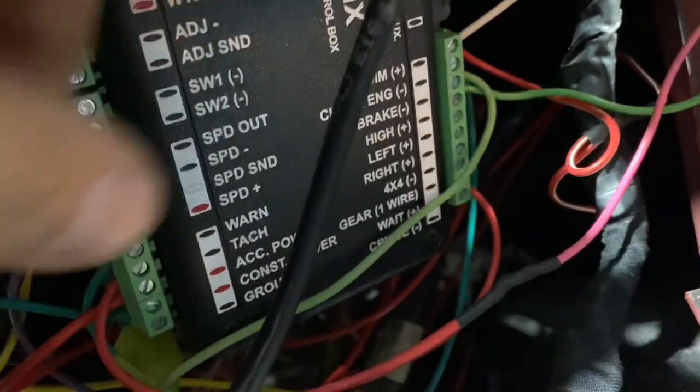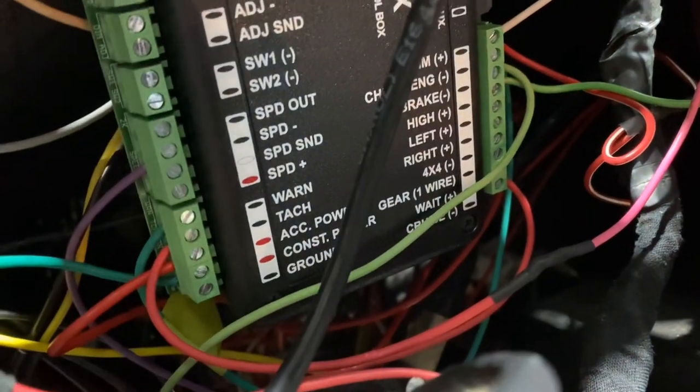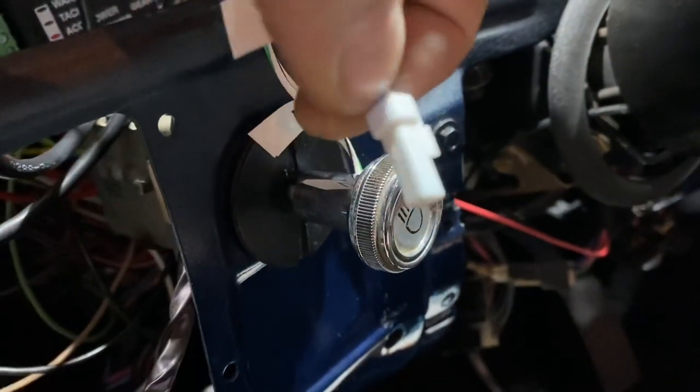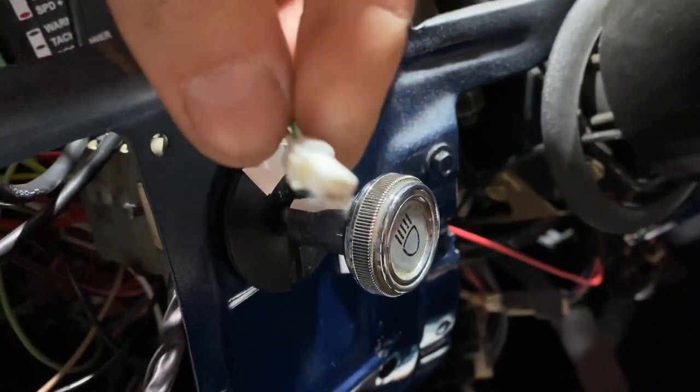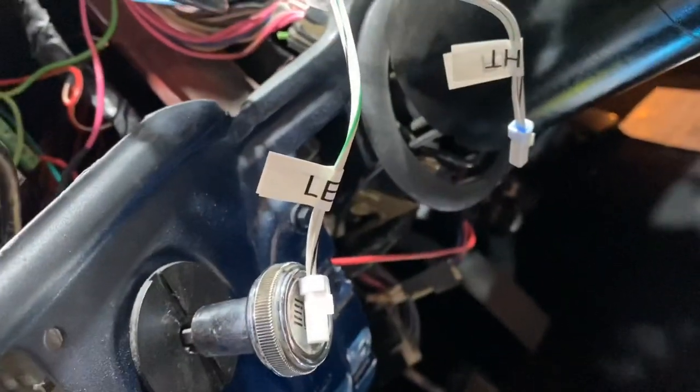So originally when I was wiring this, I had them hooked up to this left and right terminals, because that's what will actually trigger the indicators in the gauge to work. Now, when you buy the gauges, it comes with two of these connectors, just little two-pin ground and positive connectors. If you look at the back of the cluster, there's the two spots. You have the main connector there, and then you have a spot there and a spot there. So, simple as that. Just wire the one side up to power, the other side to ground, and now they work as they should.